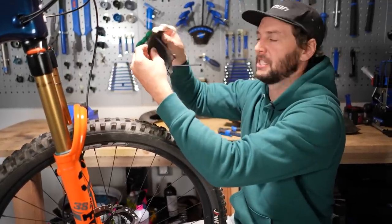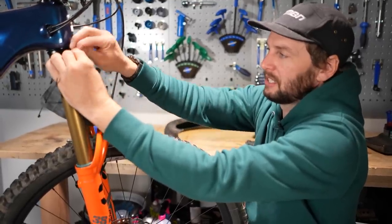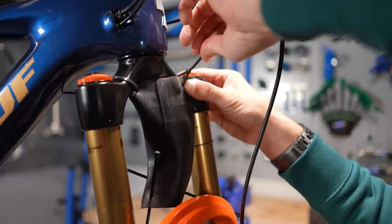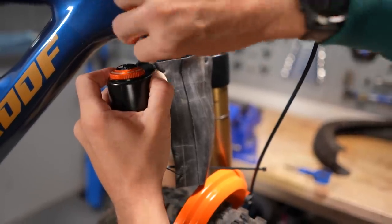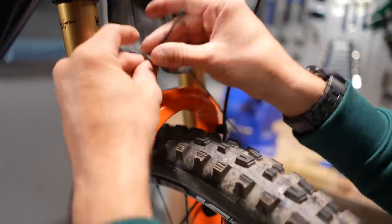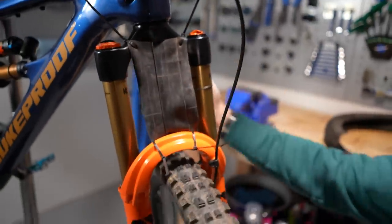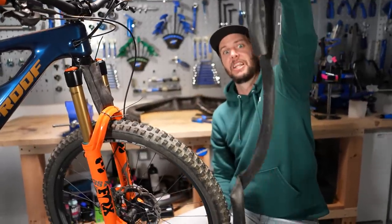You've got what looks like a crazy piece of rubber, but it does make sense. Zip ties in all four corners, and then it's literally just a case of zip-tying this on either side. Move the tube round to the front so that when you do the zip tie up tight, it holds it. Do the same on the other side, make sure there's no gap, and pull it nice and tight down the bottom too. Snip off all the excess, and it just stops any of the spray coming up through and into your face. Great little reuse — and you've got like 10 mudguards right there from one inner tube. Cheap at twice the price.